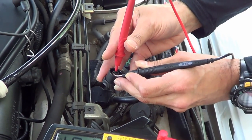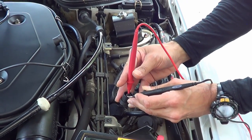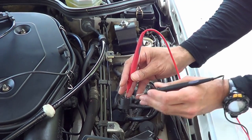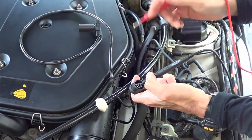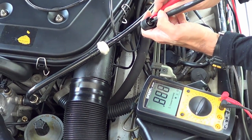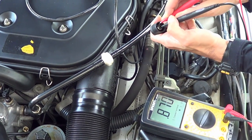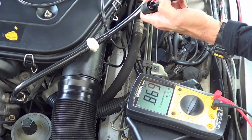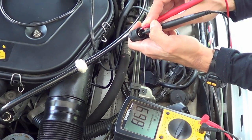On mine, when the engine has been really warm on some long drives, I've done this test and gotten somewhere near 1200 ohms, which isn't that wildly off the range. Let's have a look at the new one. Got the new one now — same kind of concept, put one probe in the center, one on the outer, and we're getting 870 ohms. Both have been roughly at the same temperature, so both seem to be in spec at least when cold.